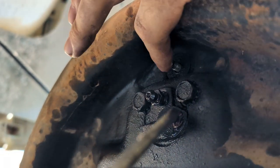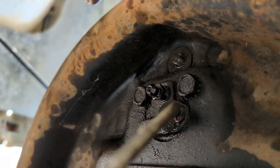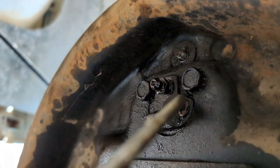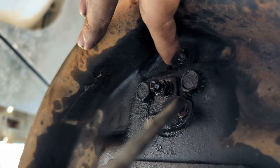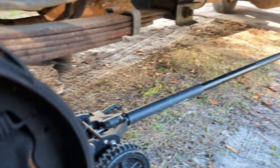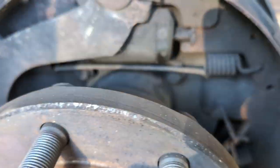And it's kind of neat. This is a splined bolt. So if you start wiggling the front where that arm is, grab that, start wiggling it, put some pressure back here, it'll wiggle out. But because it's splined, this thing won't start rotating when you go to break the nut loose. So you don't have to fight with that, which is so, so nice. But once that's out of the way, we can come back over here, and it makes it easier to start getting all these springs out.